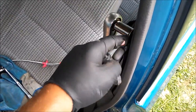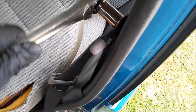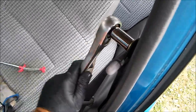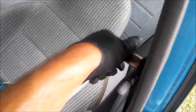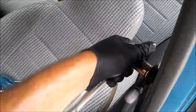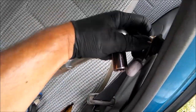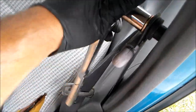I had to get a half inch drive with a 16mm for this one because it can be on there pretty tight. I learned that I was going the wrong way — I was actually tightening it instead of loosening it. Sometimes if you have a fastener that's really hard to loosen, you can actually tighten it first and then loosen it. This is coming off and it's almost off. You can see where I rounded it off a little bit — this has 6 points to it and I'm using a 12 point. Not the best method, but use what you got.